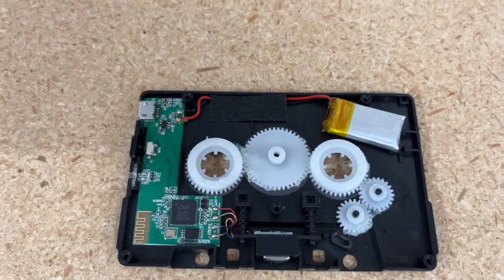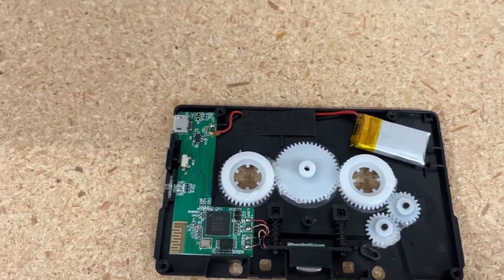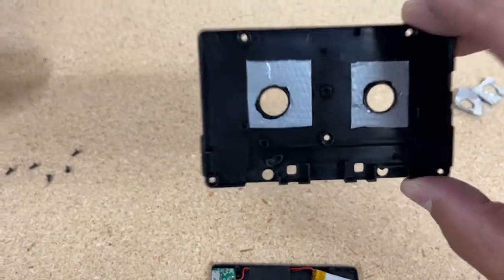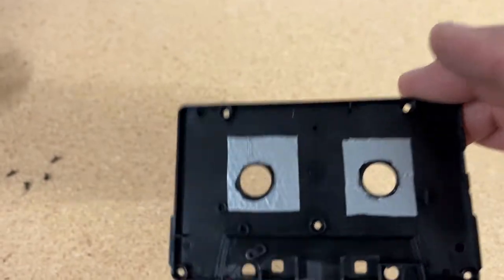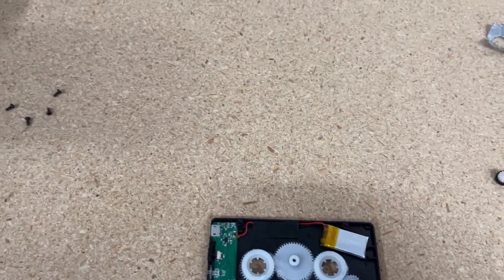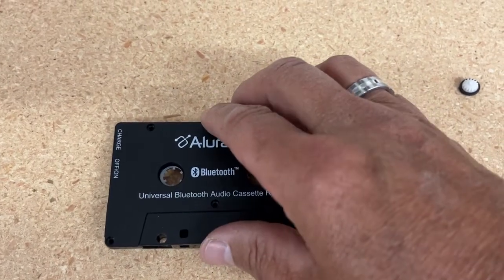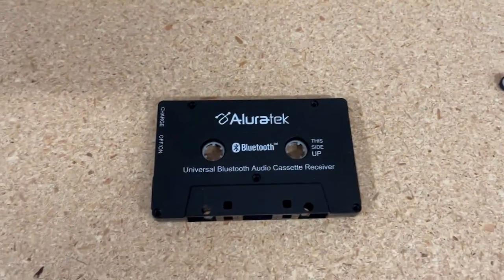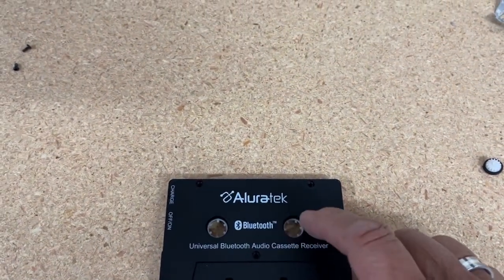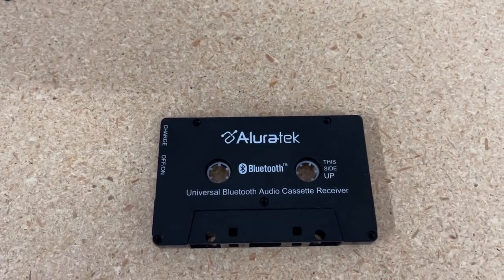I'm back. What I did was I put a few globs of petroleum jelly here and here, and on this gear, and on the tops of those — just see what happens. I also put a couple of pieces of duct tape up on top to put a little more pressure on the rotating gears, so hopefully they don't jiggle around so much. If the lubrication doesn't fix it, then I'm going to take out all the gears — the one in the middle, all of these over here — and probably just leave these two gears.